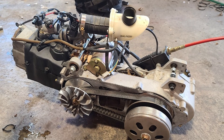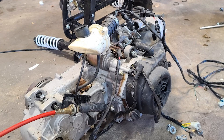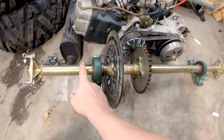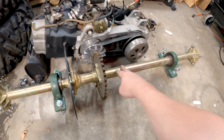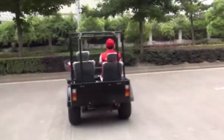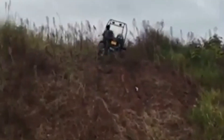Here's a shot of all the engine components after coming out. You can see there's a lot of wiring — the harness is still there. I took the brake system off because I needed to to get the axle out. I've got the shifter for the two different speeds, the exhaust, everything's there. This is what I was talking about — a single solid axle. If you know anything about differentials, this does not want to turn at all, and the tires don't slip. Those tires are big and beefy, so this was a horrible setup for pavement. On dirt it's probably fine, but we run pretty much on pavement for everything — so I needed that differential.